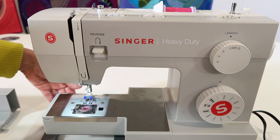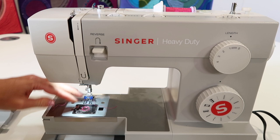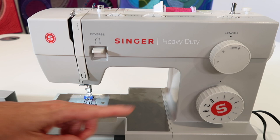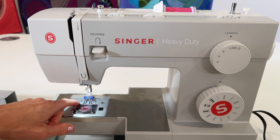Slide that accessory box off because on the back side there is a lever — peek your head behind there. Take the lever to the right and push hard. I heard a little click; those are the teeth going down. Keep in mind that when you do bring them back up, they don't come up until you actually take a stitch, whether you sew or turn the hand wheel by hand.